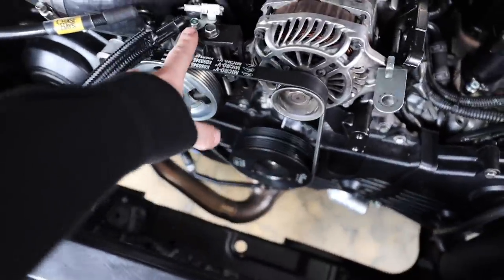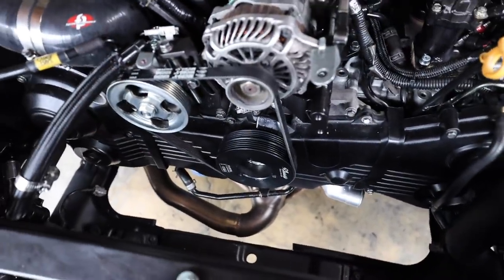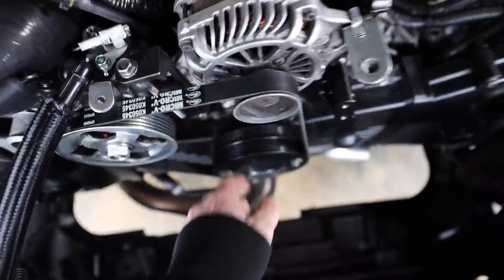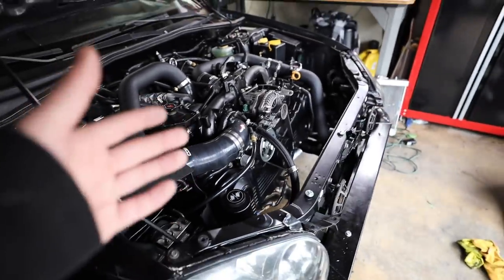Welcome from the future — it's the next day. That throttle body intake manifold issue really threw a curveball at me last night. I was able to repair it, but I can tell you right now — if that throttle body ever comes off that intake manifold, the intake manifold needs to be replaced. It's a very messy helicoil because the bolt drilled out at an angle, but it works and it's sealed up. The motor is pretty much put together at this point. For the crank pulley, I used the old AC belt wrapped around the power steering pump and crank pulley, put some vice grips on it, put the car in sixth gear, and torqued it down — torque spec was 92 foot-pounds. Now I need to drop in the radiator, plug in the fans, fill it with fluids, and we can start this thing.